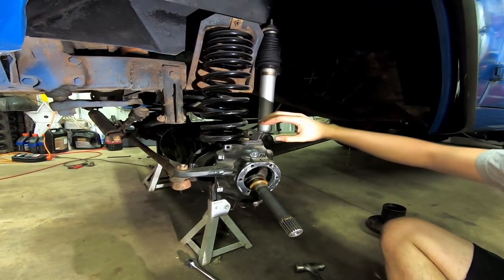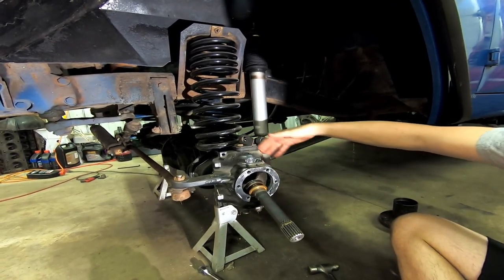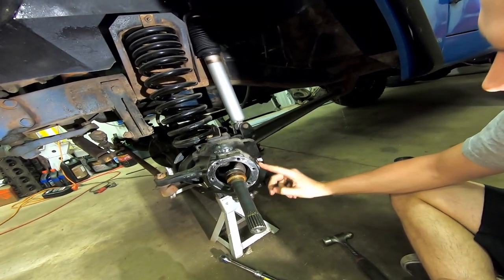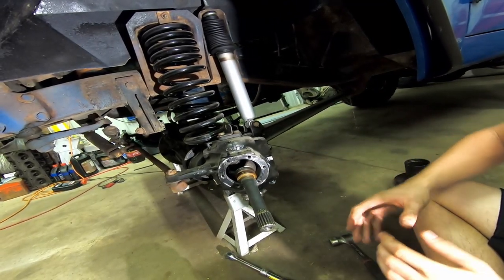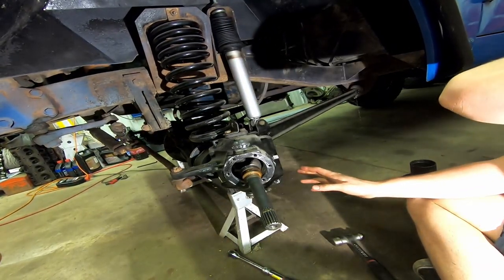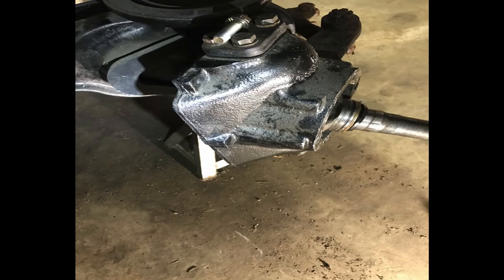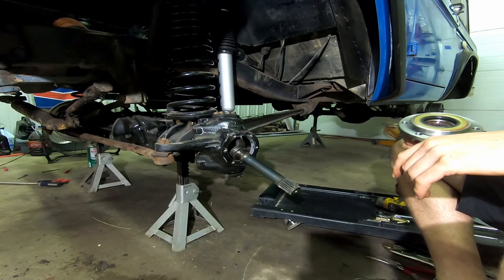The major things with this kit - it says take this off because I have a stainless steel line going from here to the back of the caliper. And then there are these right here that are going to have to be clearanced. So I'll just shave this nub and then grind this back a little bit so that you get an eighth of an inch clearance between that. I have some before and after pictures that I'll show. It's pretty easy - just get a grinder and keep going to town. I'm pretty sure almost all Bronco disc brake conversion kits for the first gens are going to require that grinding.